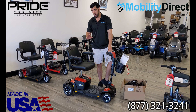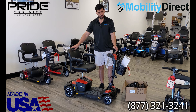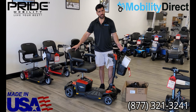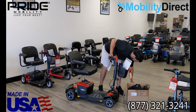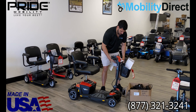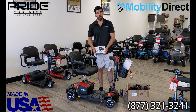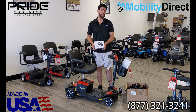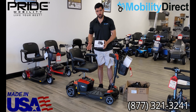It's important that you verify that the charger you're getting is exactly what this scooter calls for in the specification sheet. So if it says 3.5-amp, go to our website and search for a 3.5-amp XLR charger. This is a 5-amp XLR charger — this is too powerful. If you plug this charger into this scooter, it could damage the batteries. If you use a 2-amp battery charger on this scooter, it'll work because it's not overpowered. However, it will take a lot longer to charge your batteries. Using a 3.5-amp is what it's rated for; anything less is going to take much longer to charge.